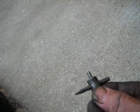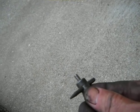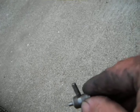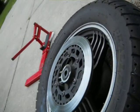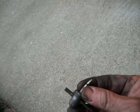This is a little tool that I have. I've had this thing my whole life. I think I bought it when I was like 12 years old for a bicycle, for like a quarter. But anyway, it's got a lot of use on it. You can actually get valve caps like this one right here that pull apart, and I've got that remover tool, okay? That little Schrader's got a top on it. You just stick her down inside of the valve stem, put it up, and unscrew it, okay? You unscrew it, and it'll go.